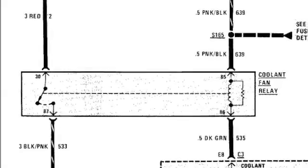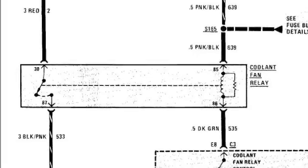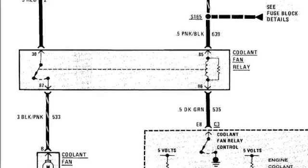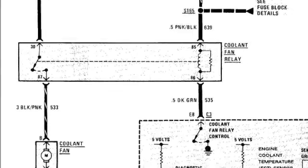If you look at your electric diagram, you can see that the two large wires at the relay — the red brings power to the relay. Once the relay is energized it sends that power to the black with pink, the other large wire. You can tell at your relays which ones are carrying power because of the size of the wire. The larger wires carry the amperage.